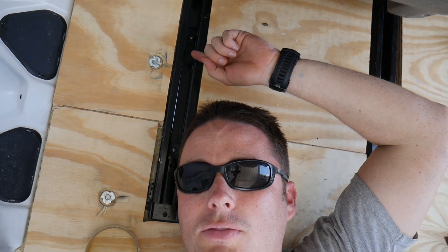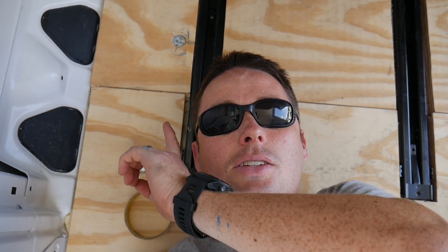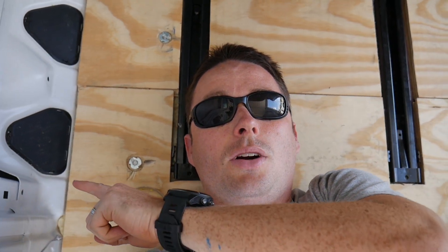The wood is going to contract and shrink and expand over a period of time, so we're going to put some caulk in there to keep water, moisture, cookie crumbs, and whatever else out. We're going to caulk around the whole van along the edges of the wood. The other thing I might do is put caulk in the small gaps along the tracks — I'm going to put a rubber guard over the top for sure, but caulking the gaps would prevent any drink spill, heaven forbid milk, from making its way down there.